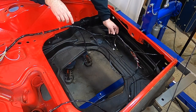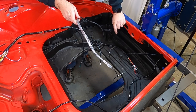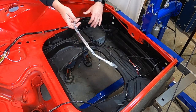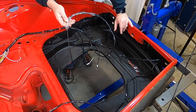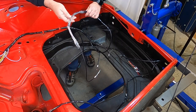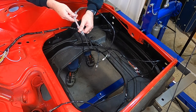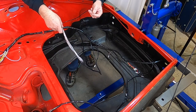To get the headlight wires ready to go through the small hole for the headlights, turn signals, and running lights, I wrap the wires with industrial wrap — basically heavy-duty saran wrap — and then tightly wrap clear packing tape over it. The reason: tape would stick to other tape, but the saran wrap comes off easily, won't damage the wires or labels, and is very smooth so it won't grab going through the hole. Then you start feeding it through — first goes the wire for the fog lamps.